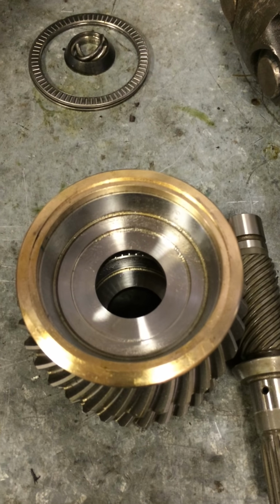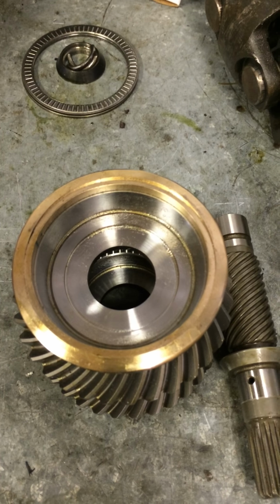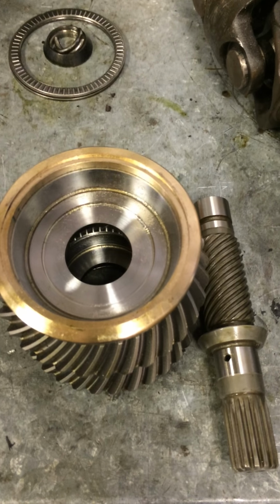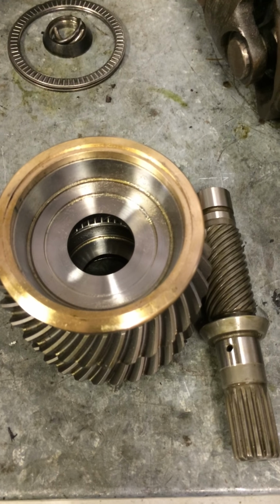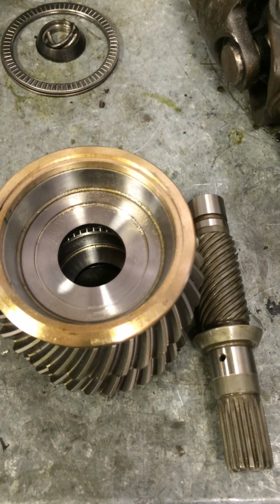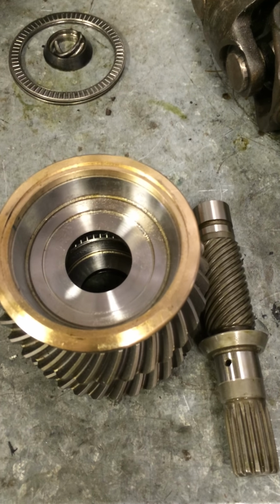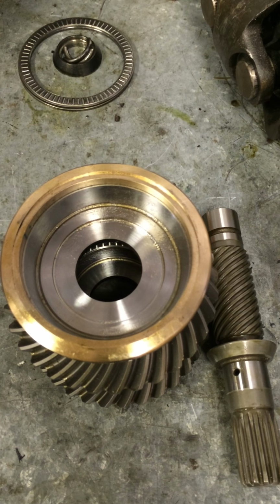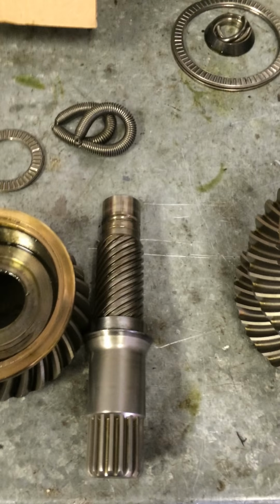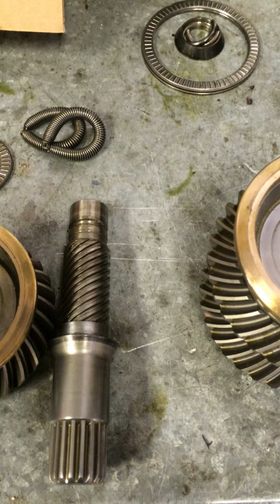Will the production gears fit on the smaller shaft? Yes. But the problem is that the smaller shaft does not fit into the housing in the gear case itself. It just spins. It's not wide enough to catch on the teeth. The new gears, which are the production type gears, do not fit on the prototype shaft because of the diameter of the hole being smaller.